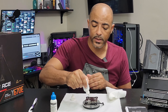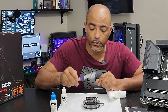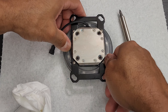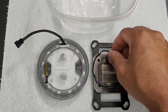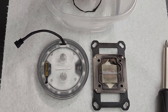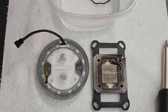It doesn't always matter how many screws there are as long as there's enough pressure on the plate to ensure good heat transfer, especially when the screws are on the outside of where the IHS is going to be touching anyway. There are more tiny grooves to get this old thermal compound out of, so I'm using a trusty toothbrush to get into some of these grooves. I also have distilled water here - I like to throw parts in there and that allows a lot of the older gunk to come off.